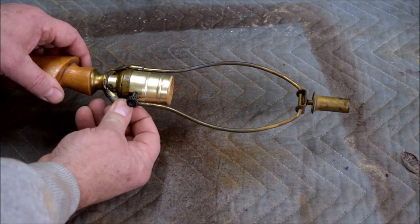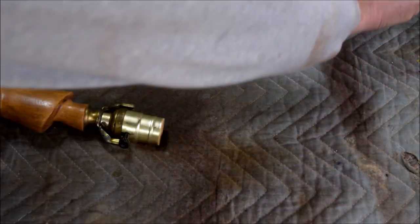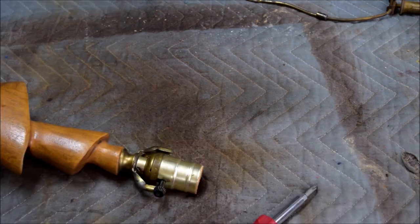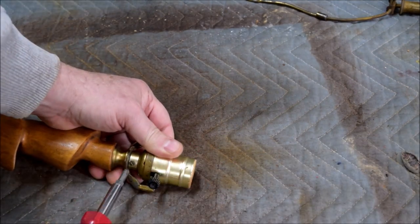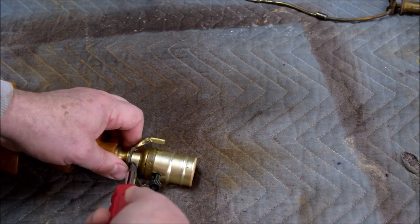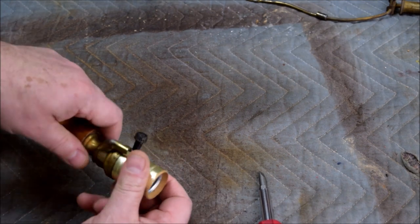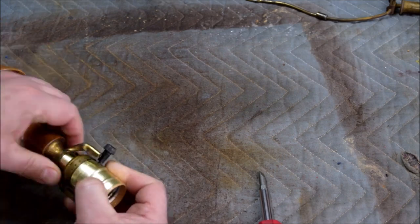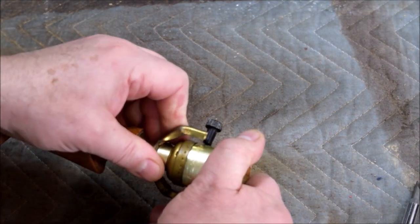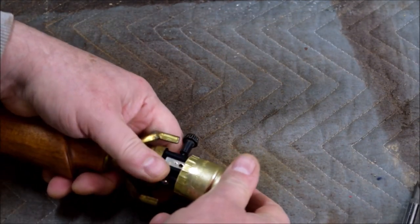The first step is to remove the harp — just slide these two pieces up, squeeze, and that's all there is to it. The order in which you disassemble these is entirely up to you; it really doesn't make that big of a difference. We're going to release this little set screw here that holds the socket, the threaded portion of the socket, down. And if you look on the socket carefully, sometimes it will tell you where to press — the word 'press' is written right there. Just press this down with your thumb. This can be a little bit fiddly, so don't get frustrated.